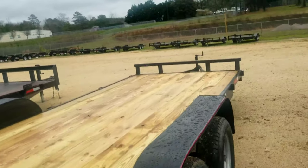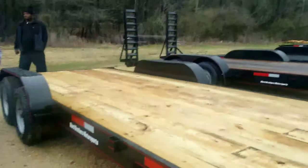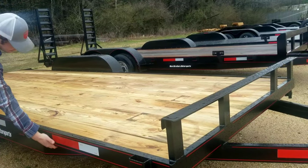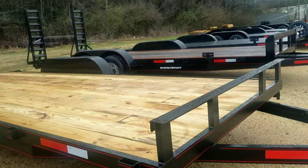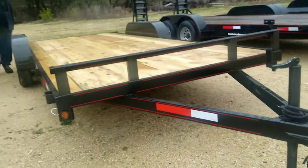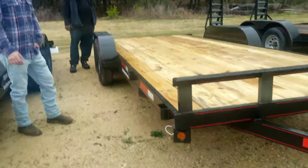As far as strapping down, I heard that strapping down from the sides is not really that good. What do you say about that? I personally, man, I've run the tire loops. It goes around the top of the tire, either grab here or here, pulling forward, and the rear ones pulling back, cinching down. Depending on your wheels, you got the axle loops. You got a big wheel, you can throw it through, snap it, so then you're basically pulling on the wheels. Just a lot of different options.